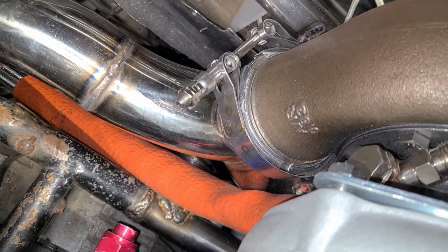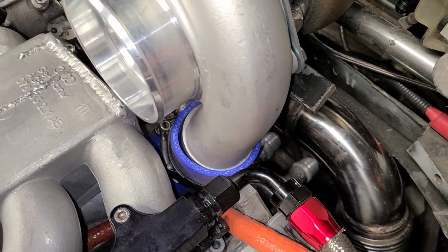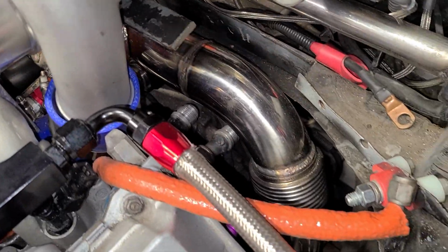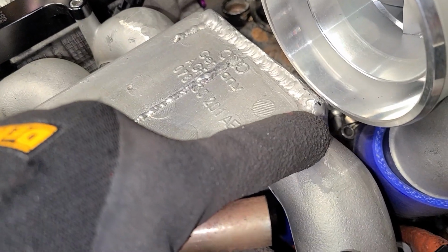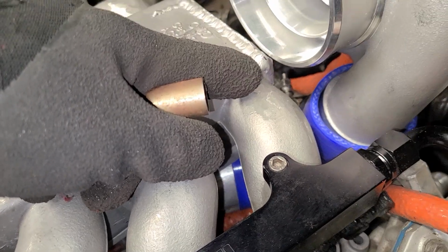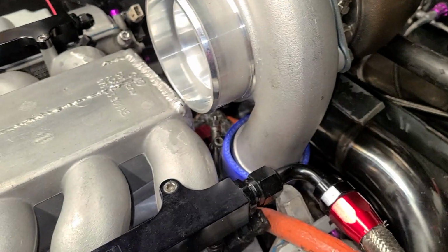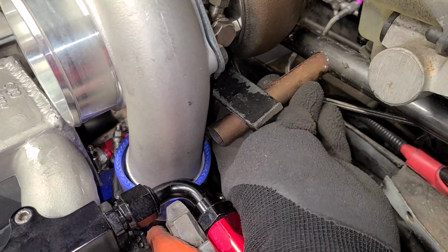Now the turbo is already clamped and tightened, as you can see, so it's pretty much in the space. As you can see, I've got movement, so it can rock back and forth without touching the bar and stuff, so it won't be rigid. And I'm going to notch away a part of the manifold I welded here. This is thicker than a 1/8 plate, so I can grind away some more of this. I will have a shield on there, so this will have to be ground down even more, but I'll get to that eventually. For right now, we're just mounting turbos.